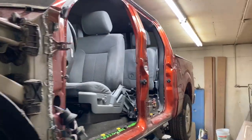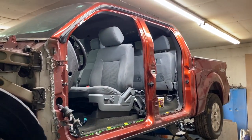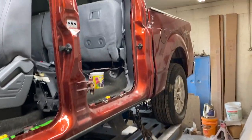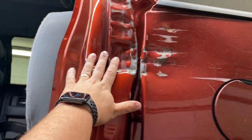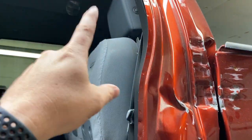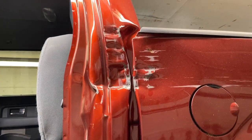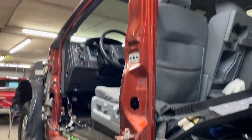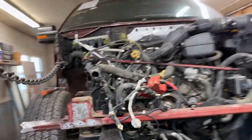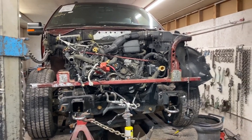He does excellent, excellent work. He was able to get the doors off no problem. After I get these doors prepped I will test fit them — the A pillar I'm pretty sure is fine, the B pillar is questionable. Coming back here, this section also needs to be cut out and he's going to try to salvage the bed. To fix this, the whole bed is going to slide back. We'll have to take out the rear window and then cut out this corner, then do the same thing with the parts truck over there so it can be sectioned in. Hopefully that's all we need to do, and by tomorrow Jack will have that corner put back together and the front end will basically be done.